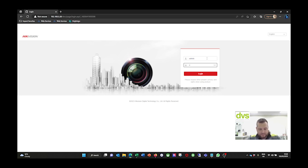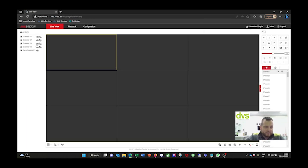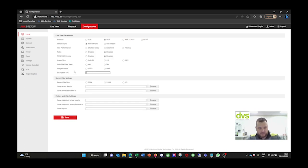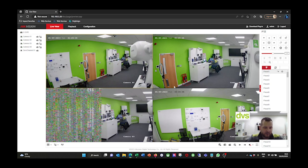Very familiar setting. As you can see, I've got four cameras added. The stream is encrypted - if you get this issue, it's very simple. Go to Configuration, go to Local, and then overtype the HiConnect verification code. This normally happens if you change the default HiConnect verification code. Go into that parameter on the web browser, update it, save it, and it should work. Put it on a four-way view and press play - all the cameras load.